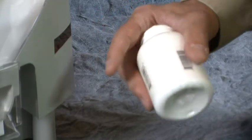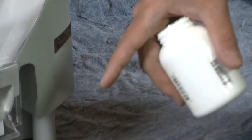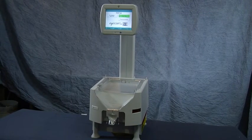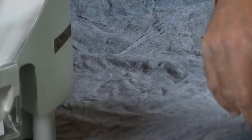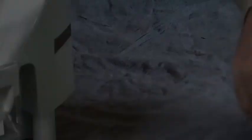If your barcode is not scanning easily, then there may be a problem with the quality of the barcode. Check your toner or ink levels in your printer to ensure that the bars are dark and crisp with clear edges on all of your bars within your barcode. You can also try to scan that barcode on another scanner within your pharmacy to validate its scannability.